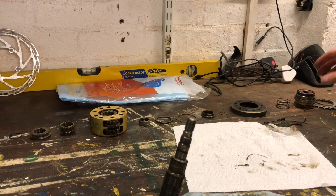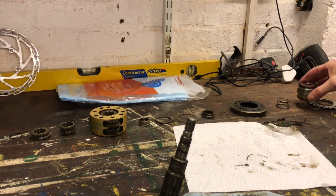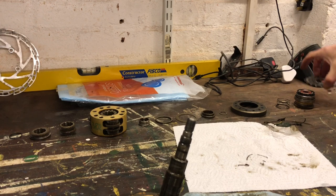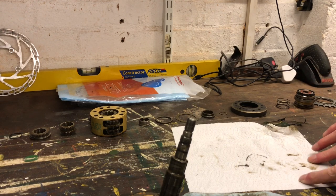Nice and easy. What I will say, this has got the newer spline carrier on it for the sprockets. The sprocket slides over there and it's held in place with a split pin. So you don't need to take that off in order to get the gearbox apart — you just need to take the sprocket off the spline carrier. That's much easier than the old system where you had to get the sprocket off on the thread, which could be interesting, shall we say.